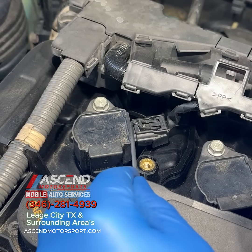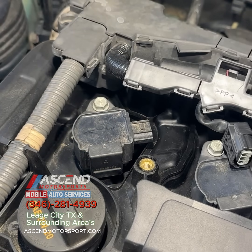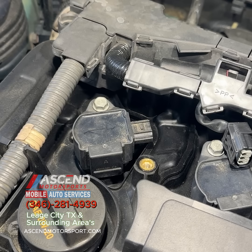If it's a coil-on-plug setup, you'll need to unplug the coil connector. Firmly grip the rubber boot — never pull on the wire itself. Gently twist it side to side and pull up.